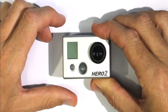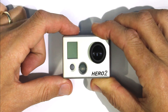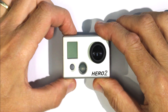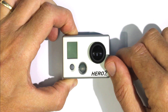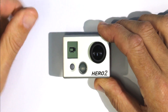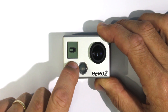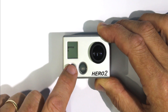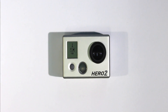Now the process of manual updating involves pressing and holding the shutter button while turning the power button on. So press and hold, keep that down. Press the power button on. The camera will turn on, then you can let go. Now you need to press the power mode button once, press it again, and press it a third time. Then the camera will start to do the manual update.